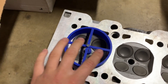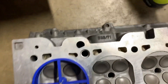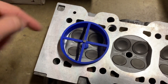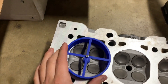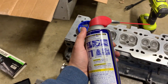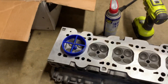This piece has a bolt hole in the center that lines up with the spark plug center, and as you can see it's pretty much centered in the bore, so this will give me a pretty accurate mold. Once I pour the Bondo in, I can insert two dowels, run a flat edge, and score a line parallel with the crankshaft. Then I can remove the screw and plug, put in the actual spark plug, and do the mold. I'm going to spray everything with WD-40 so the Bondo doesn't stick — that's what JE recommended.